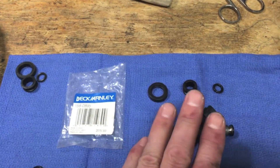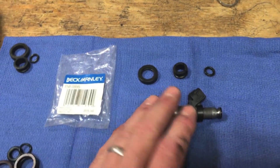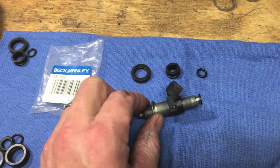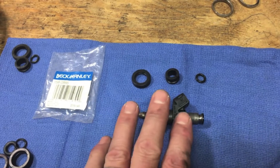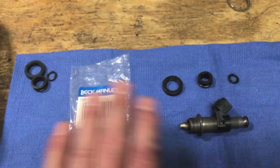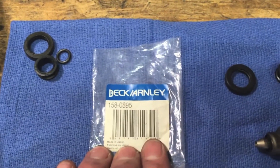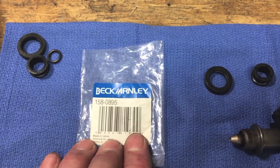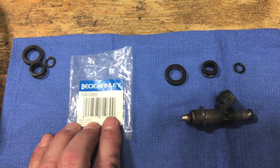I'm going to go ahead and clean this injector out with carb cleaner — I put a video out on how to do that. It's a real easy setup; you can look that up on how to clean your injector out. That's the way I'm going to do mine. This is the kit you'll need in order to do a Honda CRV — I think that goes from 98 through 2001. That should get you straightened up.